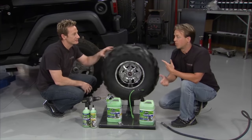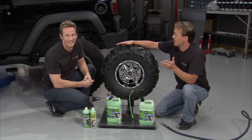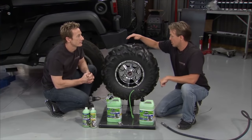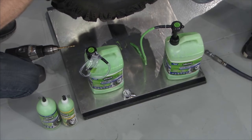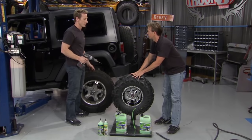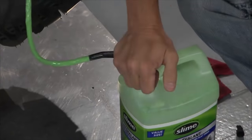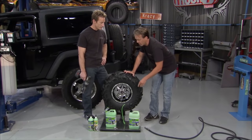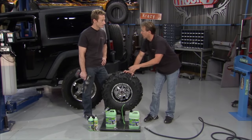When we get this Jeep back to our buddy, it's going to be set up for some serious off-roading. One inherent problem is you're going to puncture a tire out there — you never know when it's coming. But you can help prevent it from becoming a bigger problem with tire sealant. You treat the tire with slime: take out the Schrader valve, let the air out, pump in the appropriate amount of slime, put the Schrader valve back in, and inflate the tire. We pre-treated this tire and drilled a hole to demonstrate — the tire was leaking, but after spinning it the slime sealed it right up. You won't even know you had a problem.